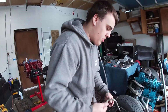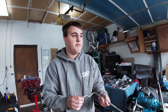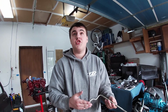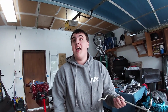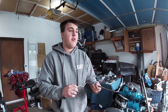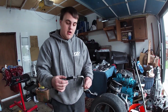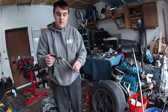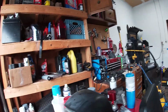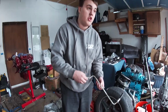The coolers, I think it literally just uses a hose that you tighten over it. Oh yeah, my transmission cooler does that. So we could actually skip the whole AN fittings and just go rubber line onto the cooler, and that'll be easy. I have tons of extra rubber. Well, no, that's really big line. We just need to buy some. Summit Racing sells them very cheap. I can buy these brand new, and I'll just do that when I get home.